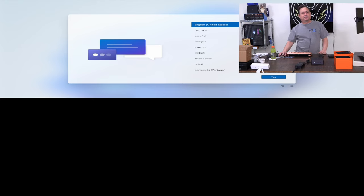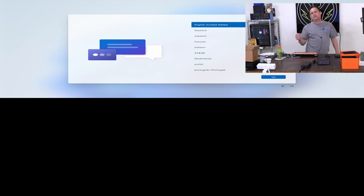This is a tricky thing to talk about because most of you would never have this problem if you're plugging it directly into a monitor. But because I'm going into a capture card, every capture card I've tried, these things using the 780M Ryzen-based RDNA 3 graphics, it's sending a signal out in a funky way. And the way I got around this before, I used a completely different capture card, which I have over here. And this is just a USB-based Camlink 4K capture card. And even with this capture card, it'll still sometimes come up funky, but we can at least make it usable.